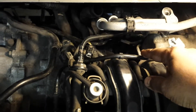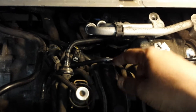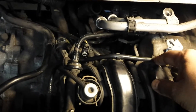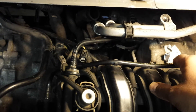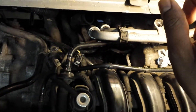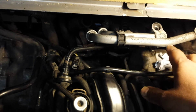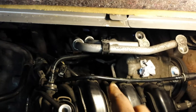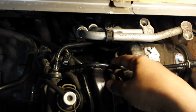Online it's suggested that you don't have to take the air conditioning pipes out to get to the starter motor, and I would agree — however it is quite difficult. As I was going through the diagnostics I also realised that this car doesn't have any refrigerant gas in the air conditioning system, so I took some tests at the front of the car which I'll record in a separate video. That showed me there was no gas in there, so I thought since there's no gas I might as well disconnect these two pipes — and when I did, it made the whole job incredibly easy.